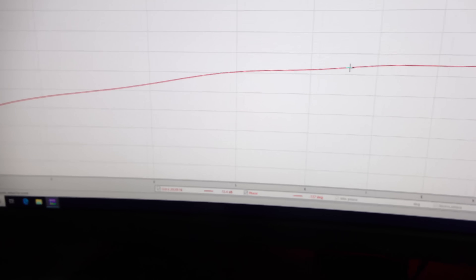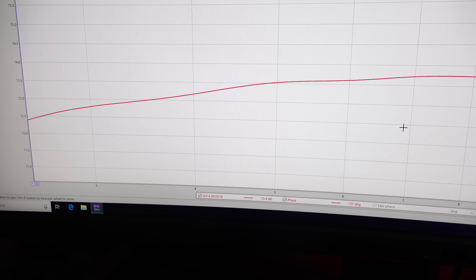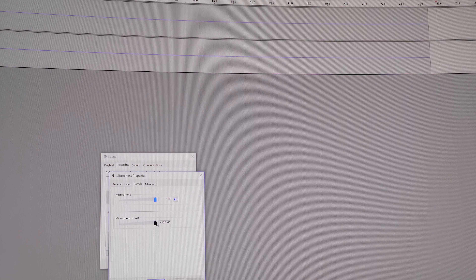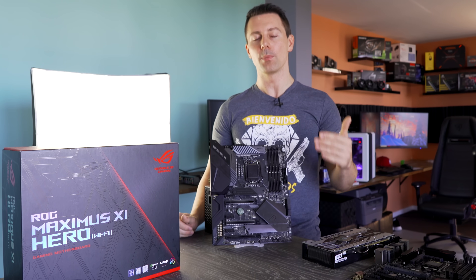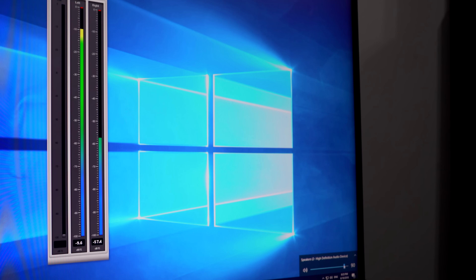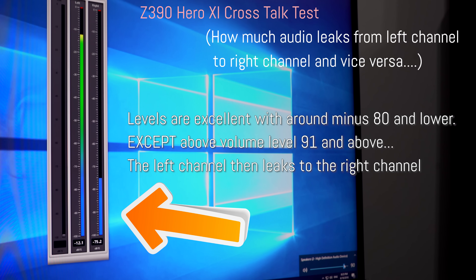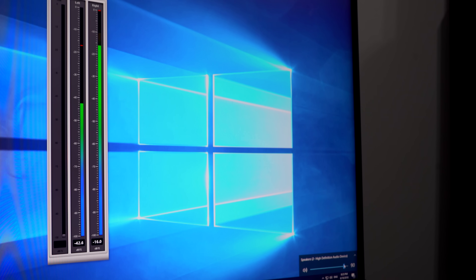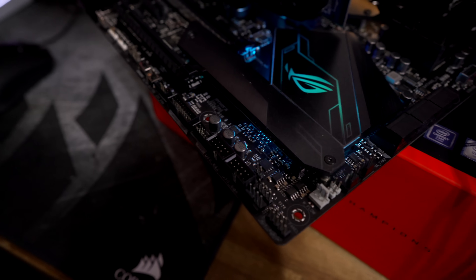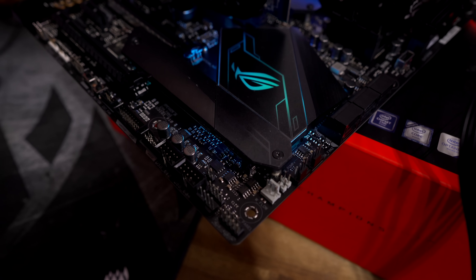The mic input also had clearly visible noise suppression when we turned the volume up to 100 — there was about a 30 dB spike when we tried to change it, which indicates noise suppression, but it will give you a clear signal. Just don't use it for professional recordings; for gaming, your mates will be able to hear you fine with no noise. Moving to the left and right channel balance, there was only a 0.1 to 0.2 decibel difference, which is phenomenal. Crosstalk numbers were minus 80 dB and lower, and the volume output is quite strong — stronger than previous generations — so you can power fairly hungry headphones. However, above volume level 90, just like a lot of other solutions using the ALC Realtek 1220, there is slight crosstalk leak into the right channel. Just set the volume to 90 or below and you'll have happy days.